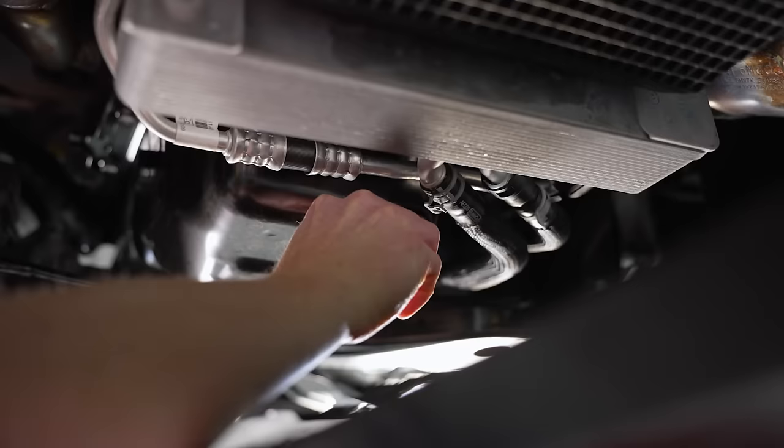If you like to write down the date and mileage, go ahead — I always keep notes in my phone of when I change the oil. We'll start the car just because we can. You usually want to check the oil hot on level ground, but I always let it idle down and check the dipstick. Just like every other Coyote, it's right here on the driver's side valve cover. Take it out, wipe it, put it back in, pull it out again — and it's right in the crosshatch. That's where we want it.